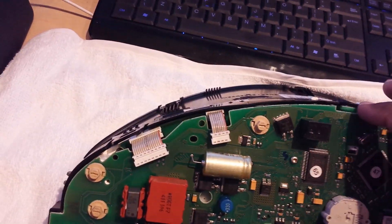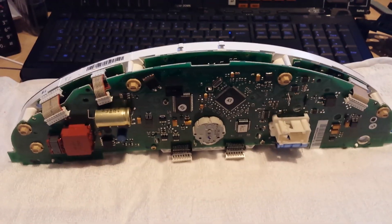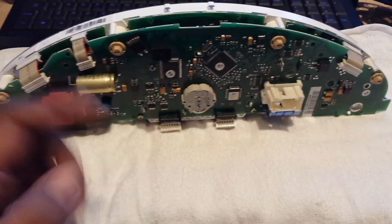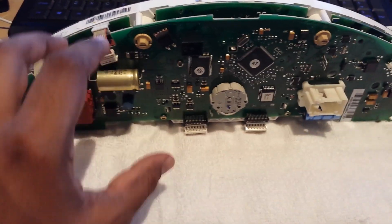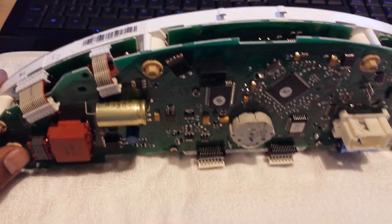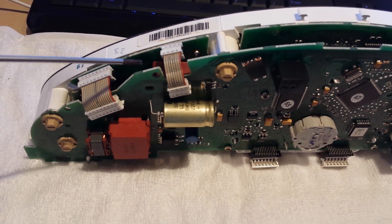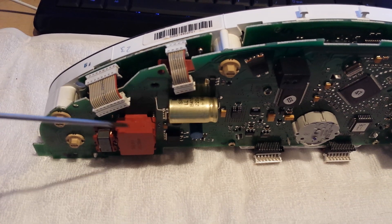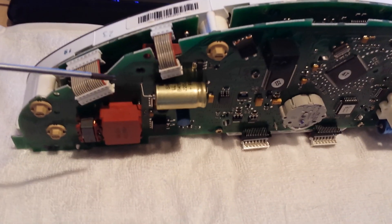Before taking the back panel out, you need to take the whole inner unit out. There were no screws or other plastic bits holding it — just lift it up gently from all sides and it comes out without effort. The transformers that go faulty are: one here, a small one there, and another on the back PCB — that one fails the most, followed by the other two. If all three are good, the fluorescent tubes may have reached end of life, though in many cases it's just the transformers that need changing.